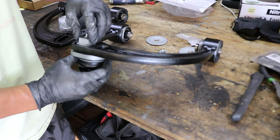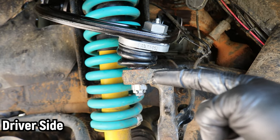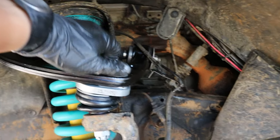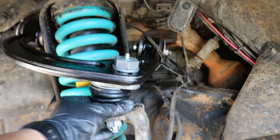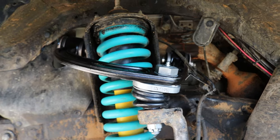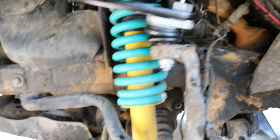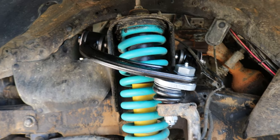So this is the spindle pushed as far forward as possible, and if we want to push backwards we just turn it around. Then this washer goes on top, then the nut goes on top of that, and I'll snug it down by hand for now. Alright guys, we're here back on the driver's side. As you can see this ball joint is pushed forward, which should push the tire forward as well. I'll loosen this upper bolt — you can see this thing can still ride on this slot, and when you tighten it we can get the camber adjusted properly. I still need to tighten several bolts, secure the ABS line, and the sway bar is still there. I still haven't torqued down this upper control arm yet either.